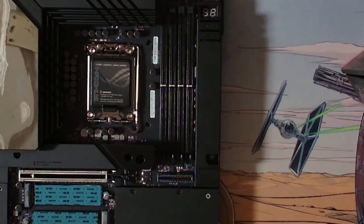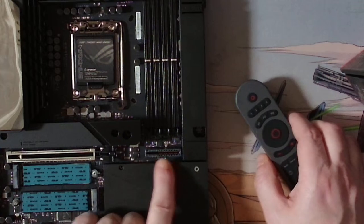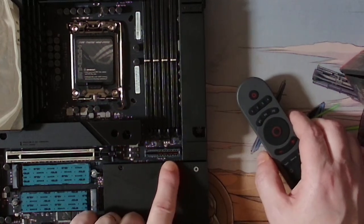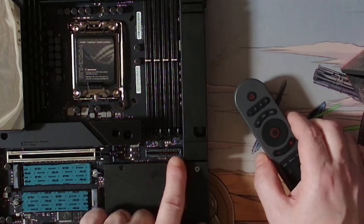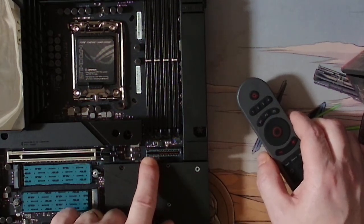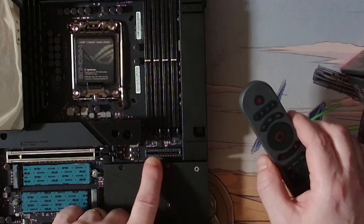Sorry about the lack of picture quality, but that's what it is. So there is your PCI Express power coming through there. That is your BTF slot, or back to front, or back to the future. That is essentially going to be able to supply you with up to 600 watts of PCI Express power. So this is the power on this side, where you've got those metal prongs there, and the smaller pins in here, which are more like PCI Express pins, but a bit bigger, those are your sense pins. So one pin means 150 watts, two pins, 300 watts, three pins would be 450 watts, and four pins would be 600 watts, if that makes sense.